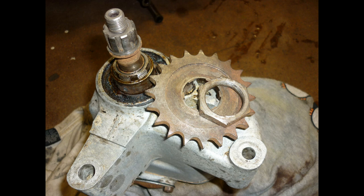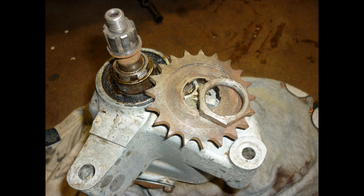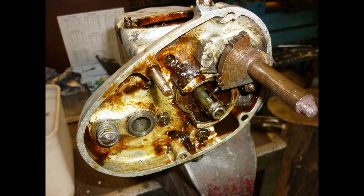1939. Burman's 8 HPB gearbox outer cover had been pulled clear on its studs, but apparently never removed. The lever between inner and outer box rises into the pressed steel cover when the low gears are selected, so the casing moves about 3/8 of an inch and stops. Selecting 3rd or 4th gear has the lever ducking low enough to clear the case.